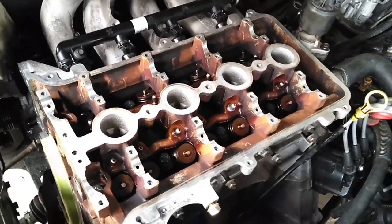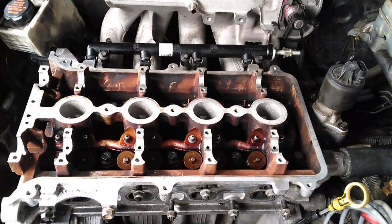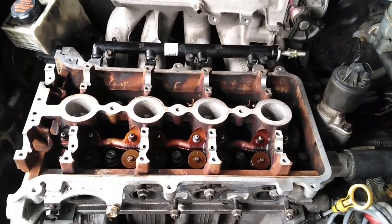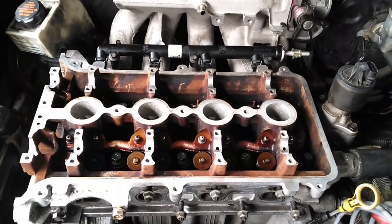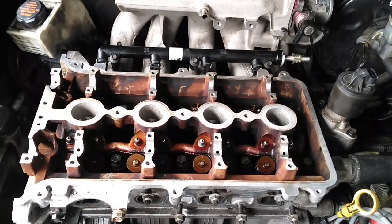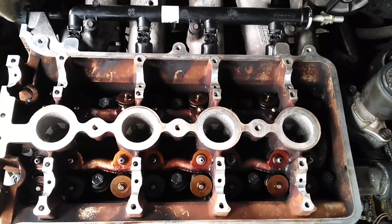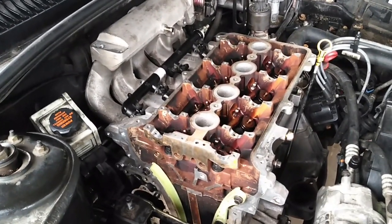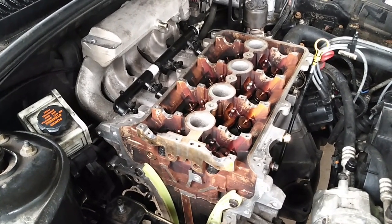Shaking a little bit from the exertion — that's the cylinder head on. I did one pass, five pounds each upgrade on all the bolts in sequence until we reached 45 to seat the head to the gasket. Dry, pulled them all out, oil wetted them, reinstalled in sequence five pounds a piece until we got to 25, then again till I got to 35, and then I turned them all 90 degrees. They all started at about the same point and ended at about the same point. Cylinder head is installed to the block. Now to build the cylinder head inside the engine — it never ends. But I feel like that went well, I feel like that sealed up. We'll find out at some point.